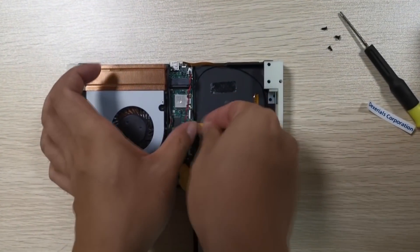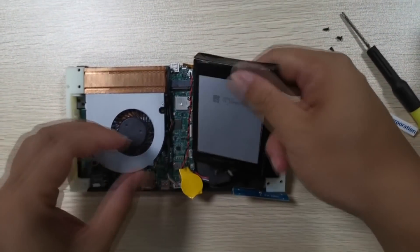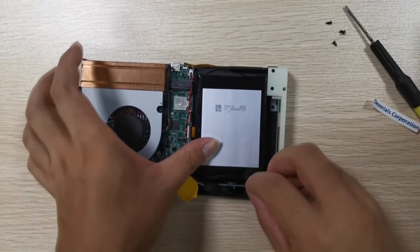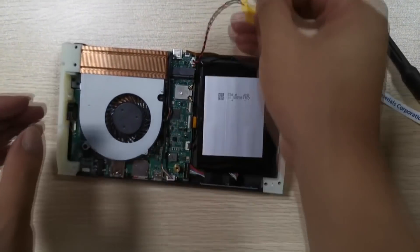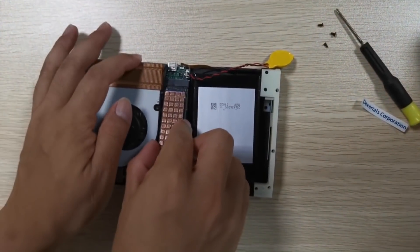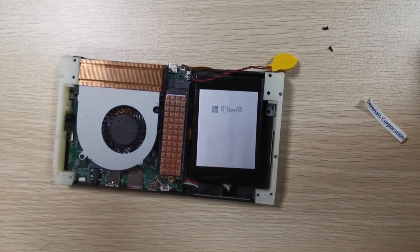Solving the eDP to MIPI conversion is one actual big problem, as well as running from battery. You can see that big 47 watt-hour battery that's going to be super heavy and somewhat off-balance on one side. Then you see that CMOS battery just kind of dangling about, which I hope they fix. And they have an NVMe SSD with a big custom-looking heatsink — like they just slapped some copper on it.